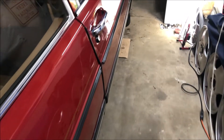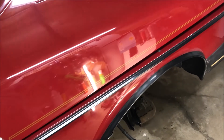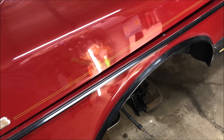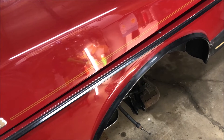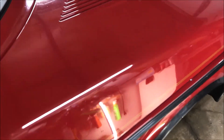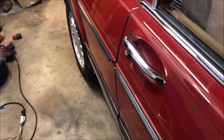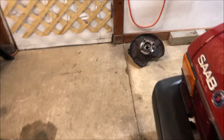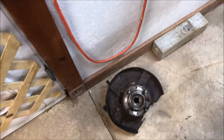Going forward, I'm going to have to get this situation dealt with up here. What's left to get this on the road? Well, this corner obviously — we've got to do the brakes, the motor mount, and then figure out why it's not running right. With the new pumps in it will run, but now it just runs kind of rough — feels like it's missing. Fingers crossed maybe it's just fouled spark plugs or something, hopefully nothing mechanical. If it ran okay before, that's probably not mechanical. I've just got junk everywhere; here's the hub — I've got to get the old ball joint out but I'm not doing that myself.